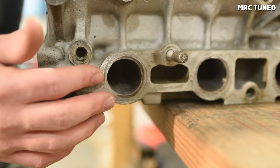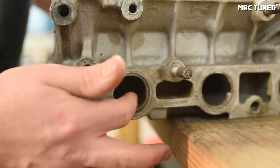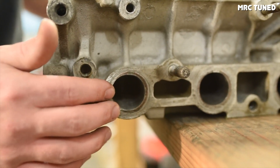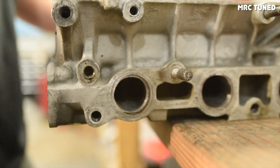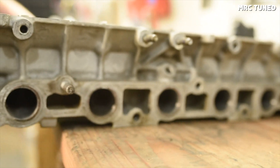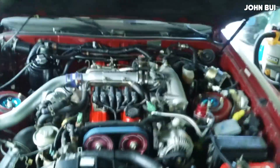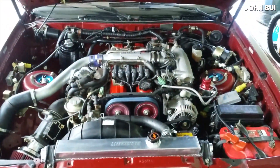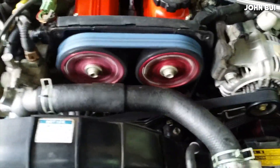This is different than the ordinary 7M GE which is naturally aspirated. If you're familiar with Toyota's typical naming scheme, this shouldn't come as much of a surprise. The 7M GTE features electronic fuel injection which was just making its way to cars in the US. We expect this feature on any car today, but back then it was a relatively new technology and it really put the 7M GTE above the pack. Naturally, with a cast iron cylinder block, the 7M GTE is a very heavy engine.